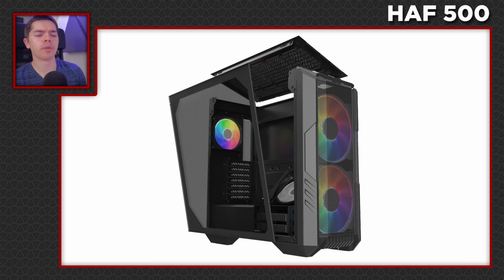We've also got a removable top panel, which I've seen in cases like the Metallic Gear Neo Air, and it is really handy. Let's say you forget to install or connect the EPS connector, the CPU power at the top left of your board, and you've already installed your CPU cooler, and I don't want to have to take that off, and my hand's too big to fit down the side because of the size of the cooler and that sort of thing. Removing that panel is much easier than removing, say, a CPU cooler and having to remount it, so it's a nice feature to have, really handy.